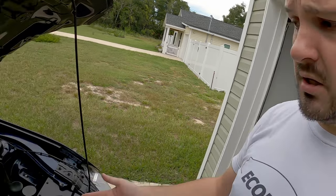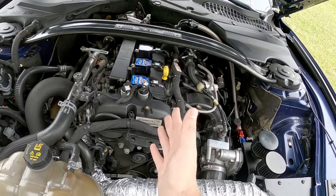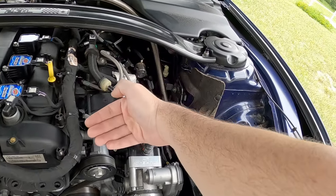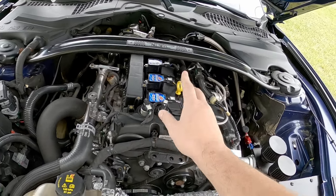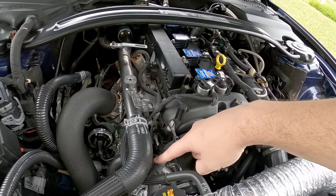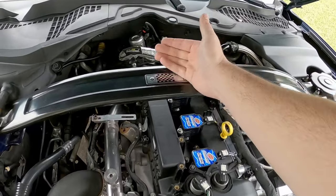It works perfectly fine. Honestly, it's probably the preferred method of alleviating pressure inside the engine. Having this port over here is kind of not needed, because how the factory system worked is under idle when you're not in boost and the engine is under vacuum, it's going to pull those vapors and fumes from the engine right into the intake manifold to be burned again. Then when you're under boost, if this is pressurized, there's actually a check valve in the baffle, so it's not sucking in anything.